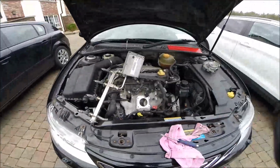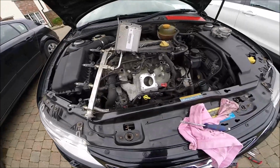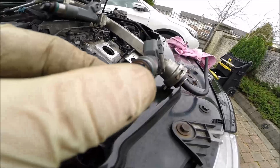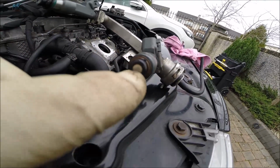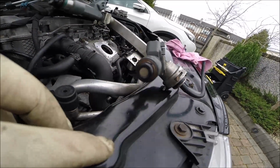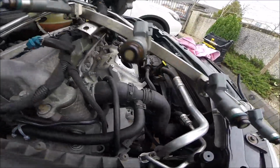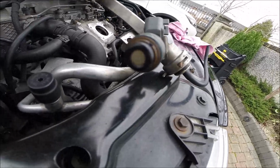Okay, so at the moment I'm happy. I know the injectors look okay. The head of the injectors is not rusty, because I expected rust here or hole damage. So my fuel trim as well is very good, so that's confirmed, the fuel system is fine.